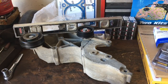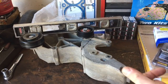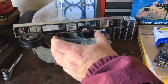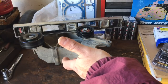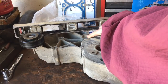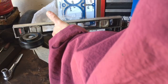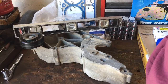That tensioner pulley is just a replacement pulley for the tensioner that bolts to your water pump. What he did was actually take part of a factory tensioner off of a water pump and milled it or ground it or cut it. This is just one of the holes that mounts to the cylinder head that holds your alternator bracket. He basically made some kind of a spacer that sits in here somehow and allows you to mount this pulley.